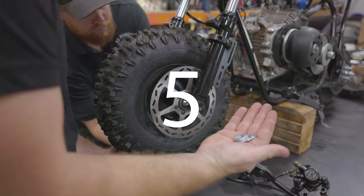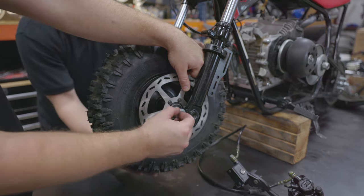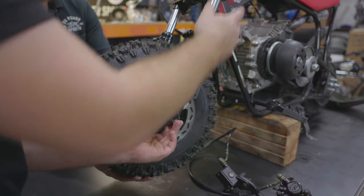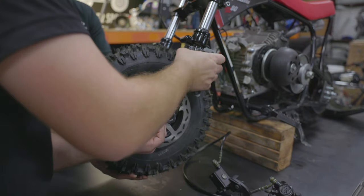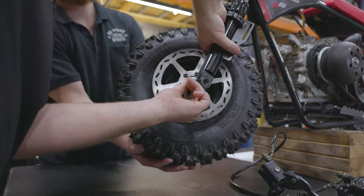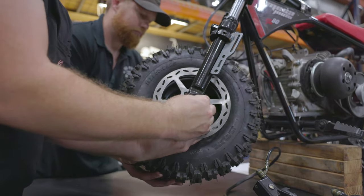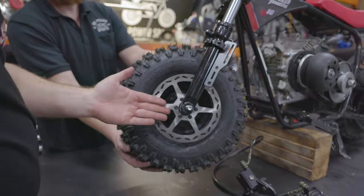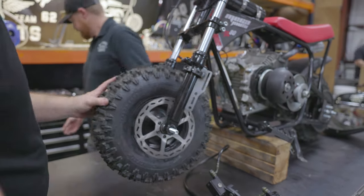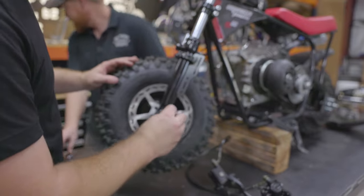So now we've got five spacers on this side. I'm going to move this forward — push that bolt through here more. Now since this is loosened up a hair, I'm going to rotate that and then push it to where it's in line. Five spacers, two spacers — you have to use all five. I promise loosening that up is a good tip. Now we're going to add our axle mounting bracket to this side and get our nut started.